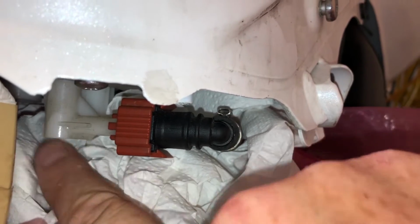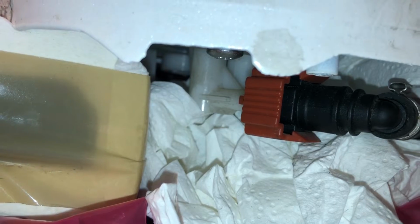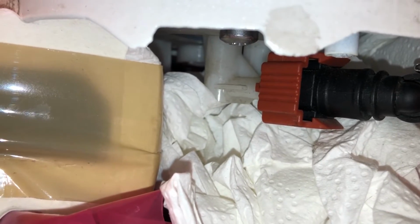So here's my fuel hose. I want to disconnect it here. So this brown clip will move back. Yep, that looks like as much as it moves back. And I'm going to somehow have to squeeze the sides of that to get that off. It'll be self-sealing, but I'm going to stand up so I'm not in eye line of the thing when it sprays a bit of fuel.